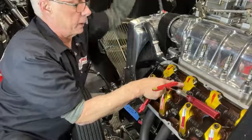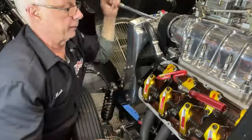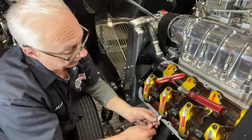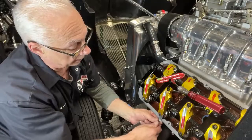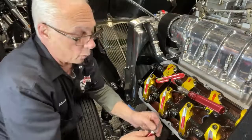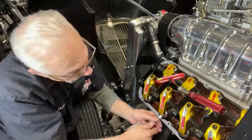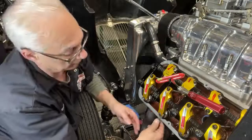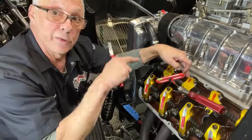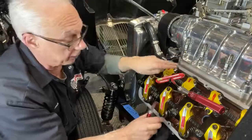Watch the intake valve. The intake valve is opening, and remember — exhaust opening, intake closing. As the intake is closing, then you go to the exhaust, which on my setup happens to be 24 thousandths. I got 24 here — just like I said, it's not very tight, just enough, snug. Where I couldn't get a 25 thou in, and a 23 would be too loose. As the intake is starting to close, almost closed, do the exhaust.